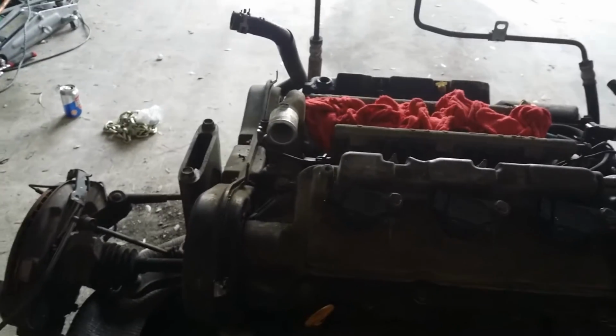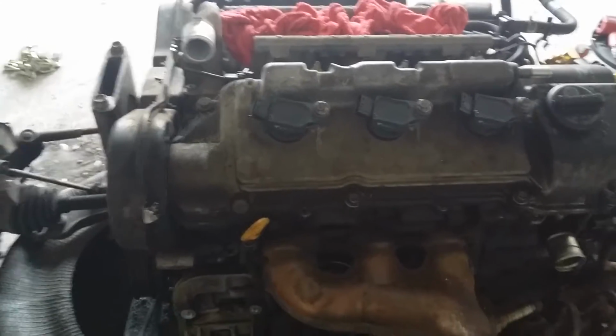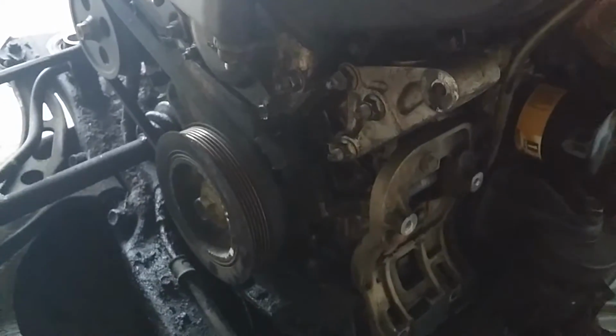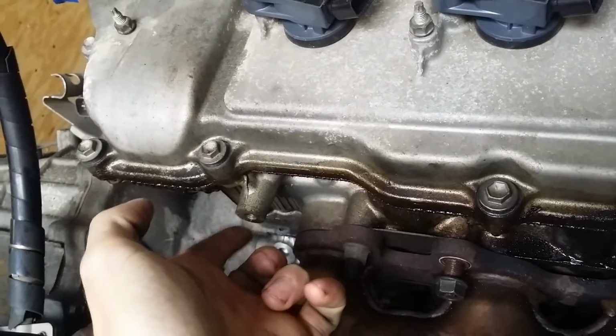I got a chain and some grade bolts. Well, they're not grades, they're metric. So metric 8.8 and higher. 8.8 is equivalent to grade 5. So we are going to, there's a cloudy light in the way, gross. Where am I gonna hook this? Oh, this here. I figured the alternator mount is a pretty solid place to mount it. It's the only place I could find. I was gonna do it in these header bolts, but they don't come out, at least with my tools. And the other one, there was a little bracket bolt right here. I got a bolt to go in there.